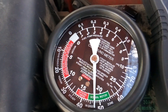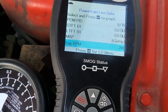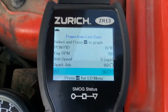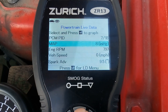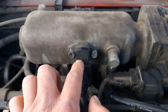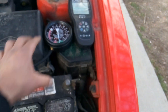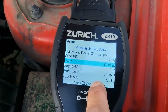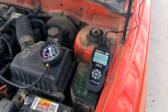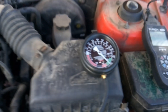That discrepancy tells us there's nothing mechanically wrong, and that the absolute pressure inside the engine is actually where it needs to be. It's the actual MAP sensor that is not reading correctly. The intake air temperature sensor is also reading correctly even though we have a code saying it's not. Since the mechanical gauge tells us everything is within normal parameters, there's no need to check engine compression, fuel pressure, or anything else — we now know mechanically everything is good.